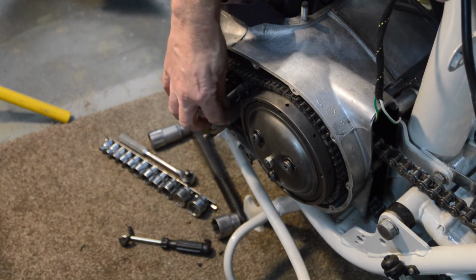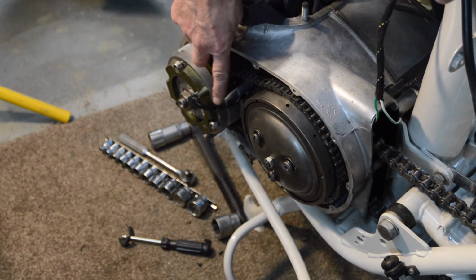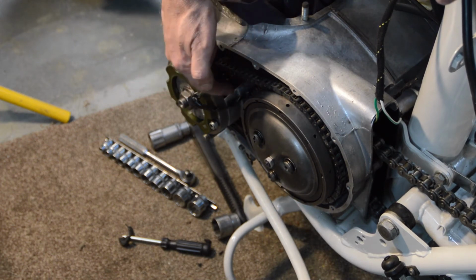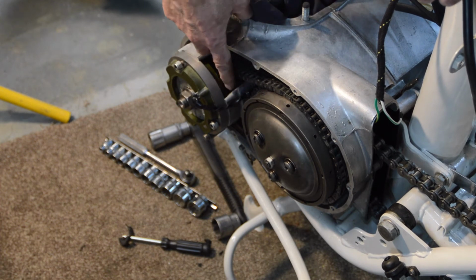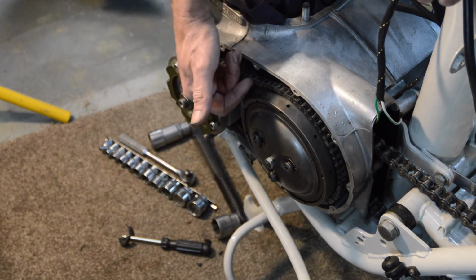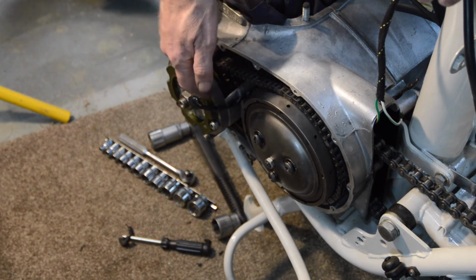So it doesn't hold the wires together tight enough, which allows them to twist, which they are at the minute slightly, which I'll do something about in a minute. They should be tighter together, which would allow the passage through the hole much, much easier. The rubber boot, which I've replaced with an aftermarket one, the hole was too small. I had to open that out to make it fit inside there. And finally, the metal clip, which I had to deform to get out, is not currently available. So I had to reshape it, and it's now in place. I got it in despite it being tight with this all being like this, which is why the manual says do it a different way.